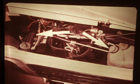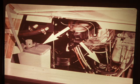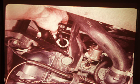Check the water in all the batteries and the level of the engine coolant in the plastic reservoir. Replenish them, if necessary, using only a mixture of 50% glycol antifreeze and 50% water for the coolant reservoir. Also, check the oil level in the chassis engine and motor generator, plus the washer fluid in the windshield washer reservoir. With the engine cover removed and the engine off, check the power steering fluid level. If it is low, repair any leakage and add GM power steering fluid.